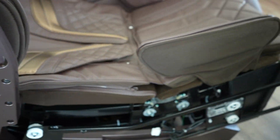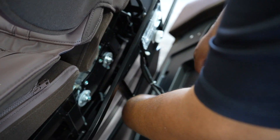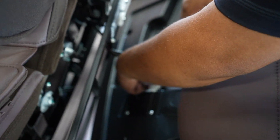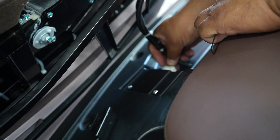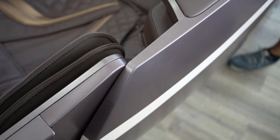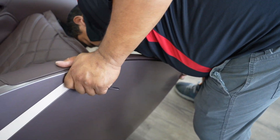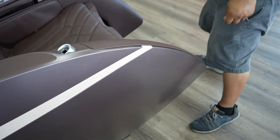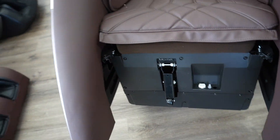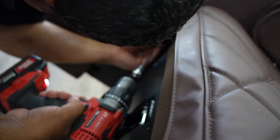Now we're going to get the right side panel and put it in place. You can see there's a hole here on the side of the chair itself — there's the electrical and air hose, wire tied to the frame. You leave the white wire ties on, but the black one that kept it to the frame will come out. Then we'll do the air hose plug-in. This is the most common thing that will cause the air bladders in the arm not to work — if your assembly crew does not attach that. You can see how easy it is to put that in place on the side. You push it in, push it back, so the front side panel just clicked into place. And now we're going to use the two bolts for the right side panel.